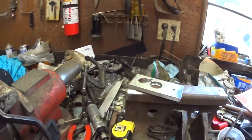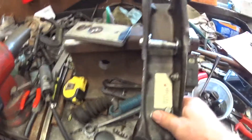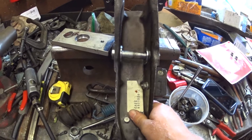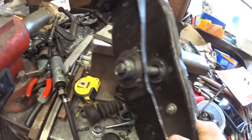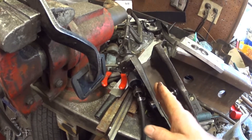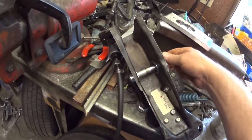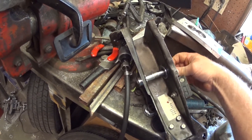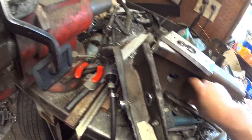I'm going to try to show this. If I lay this here and put the shaft through, it looks like the shaft is crooked. But it has to be that way, because this cradle sits crooked in the car. It took a little bit of goofing around to get these two metal surfaces bent just right, so that when these bushings go in, they are in alignment with each other and there's no binding of the bearings. Once I got it in place, I realized it's not going to stay there if I don't weld it. So I did.